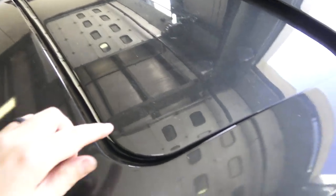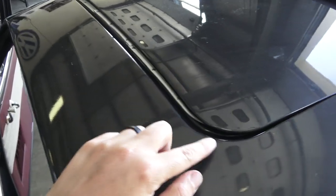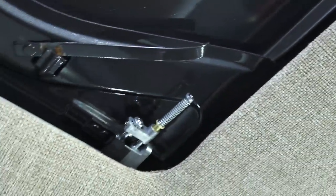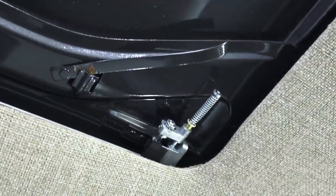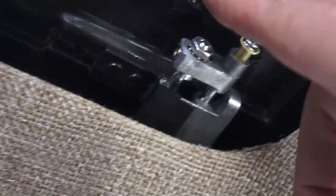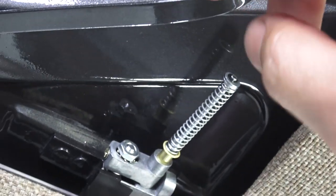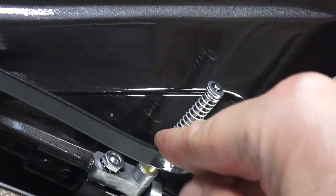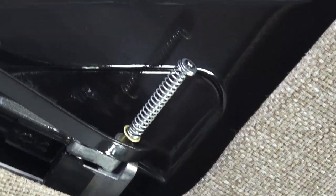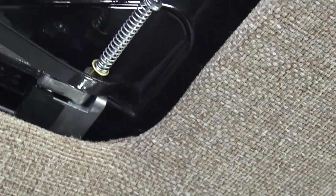Get your steel roof and plant it in. Make sure you put all your covers on and screw everything down — again, don't torque it too much since it's plastic. Get those pivots on the pivot arms positioned inside the steel roof where there's a section for them to slide right into. There's also a steel strap that goes underneath the arm to help it raise when it comes time to close the roof.